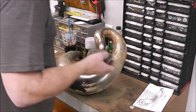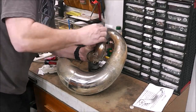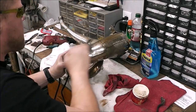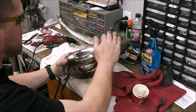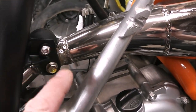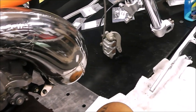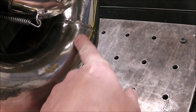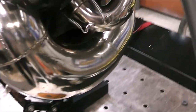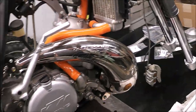What really ended up working well — kind of an experiment — is combining the steel wool with a waterless car wash spray. I just spray it on and wipe it down, and look how good that works. Steel wool works great on chrome — takes out rust and pits. The pipe is back on with some upgraded hardware. It's got a tiny ding but I'm not worried about it. This is an FMF Gnarly gold series pipe, so I'm going to leave it just like this without the guard.